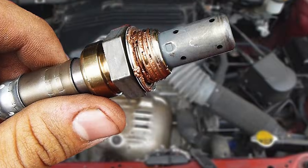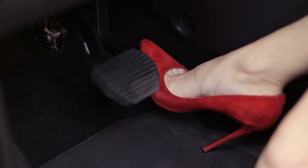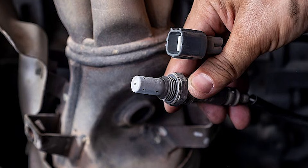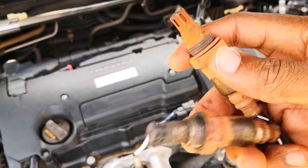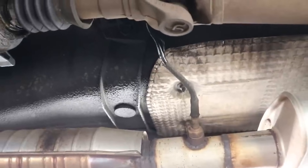This could be because the oxygen sensor is broken or for another reason. To check if it's the oxygen sensor, press the gas pedal. If it's working right, you'll see the voltage go up right away. If not, the sensor is probably broken. The second test is only for oxygen sensors that have a heater, and you can do it for sensors before or after the catalytic converter.